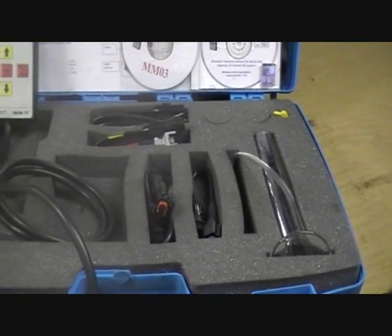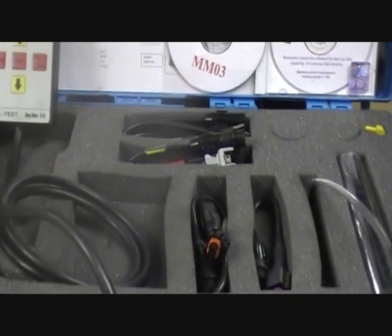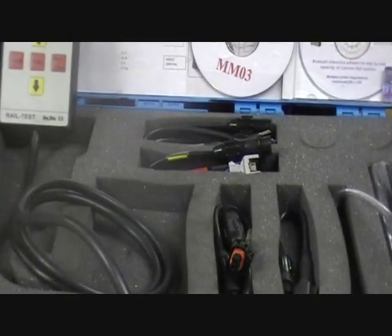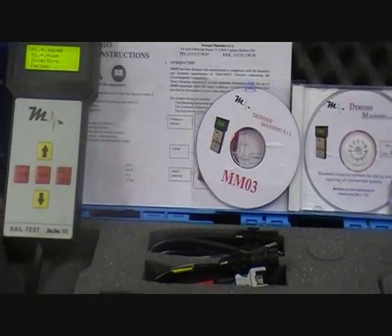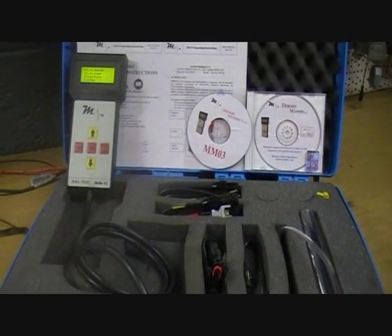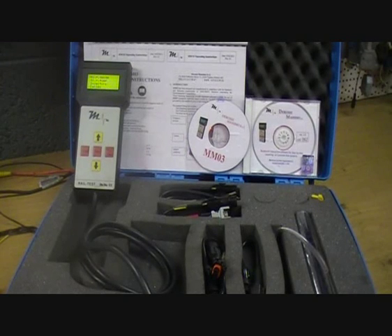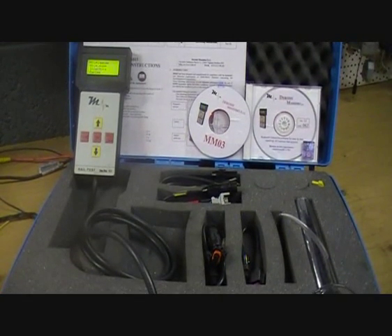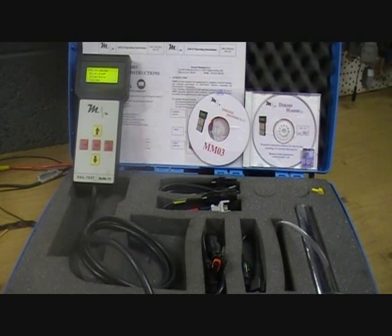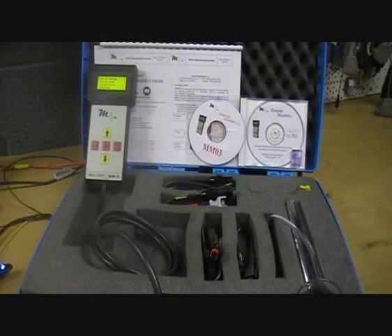On the car, the MM03, in complete independence of the ECU, can perform these functions: test common rail pressure in any working condition, and also has automatic recognition of pressure sensor brand as well as testing its efficiency. It can also manage and control testing of the high pressure efficiency by allowing the operator to regulate the pressure from 0 to 1500 bar depending upon the Common Rail system.